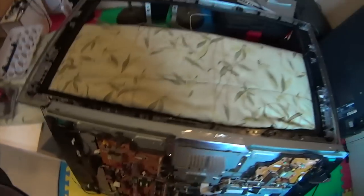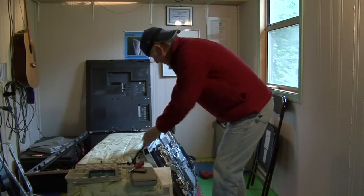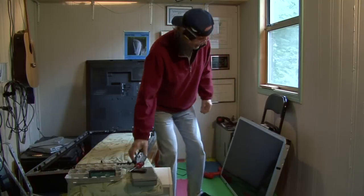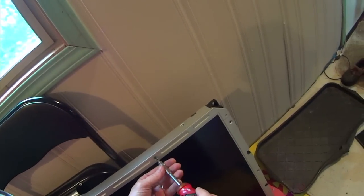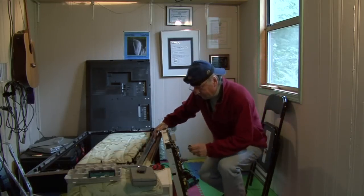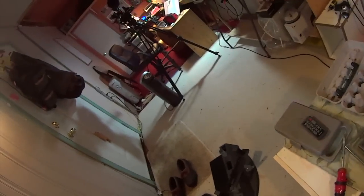So we're almost there. Now the first time I did this, this foil really didn't want to come off, but you've got to take that foil off to get the outside frame off. To get this outside frame off, it's pretty easy — it's just a bunch of screws right in the front on this aluminum frame, and they are small Phillips. On the back there are also these small clips that are just pressure fitted on. You have to take those off to get the aluminum frame out, and then you can get at those tabs.